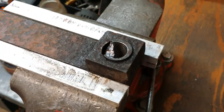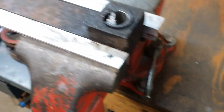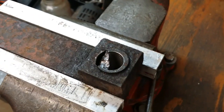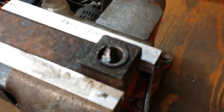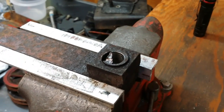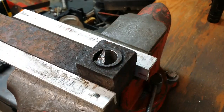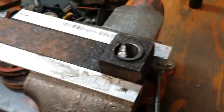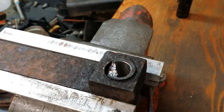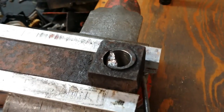With a little bit of heat and a hammer and punch, I'm able to clip that edge and start to fold the piece I cut in. I didn't cut it all the way through because I didn't want to touch the knuckle itself, so I'm having to hit it with some force. I'll just keep working it down - hopefully I can get at least one side off, then shrink this corner in a bit and the whole piece should come out without damaging anything.